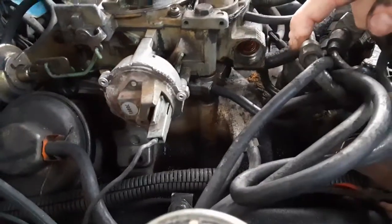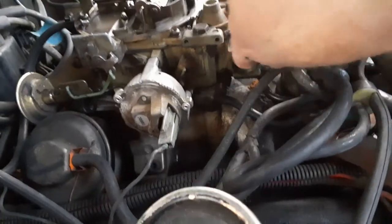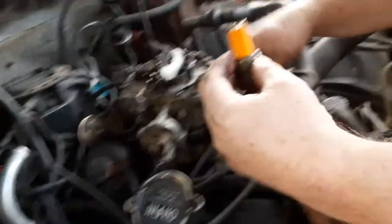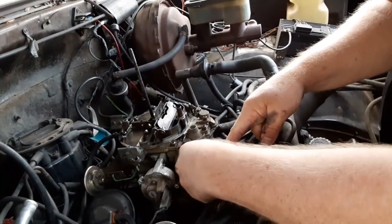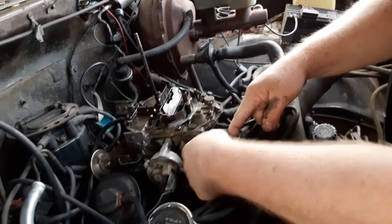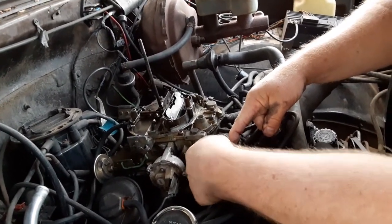There's a spring — if you look in there real close in the center you'll see it. You want to install the new filter the right way: with the rubber end and that end going towards the fuel line. Be gentle — do not do this with a wrench. Do it by hand. It'll easily thread back on there; you don't have to be aggressive with it whatsoever.